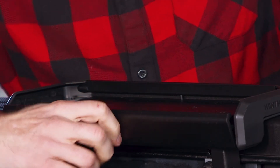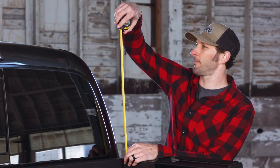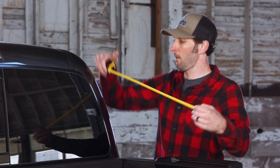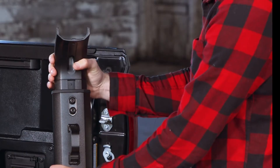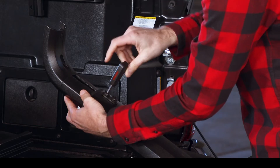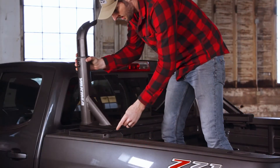Open the bases by using the 4 millimeter and 6 millimeter wrenches to loosen the spring-loaded receivers. Before you install your towers, set their height — measure from your bed rail to where you want your crossbars to be, like even with your cab's roof or an existing rack's crossbar. Loosen the tower bolts, then use the scale on the upright to set each tower to the measurement you want, and fully tighten the tower bolts with a 6 millimeter wrench.